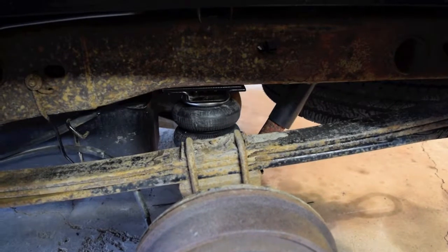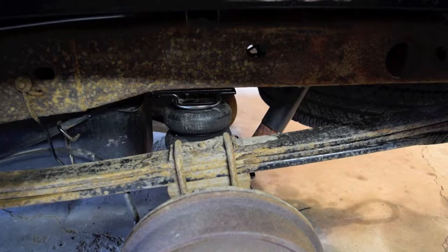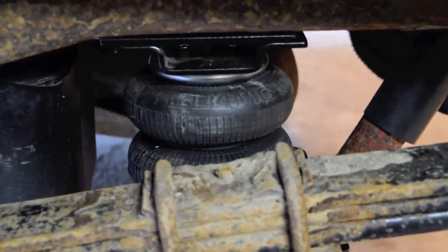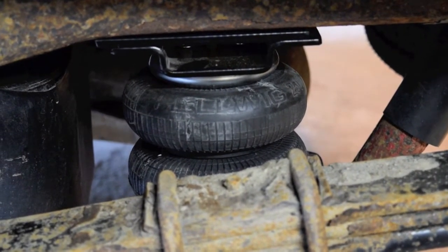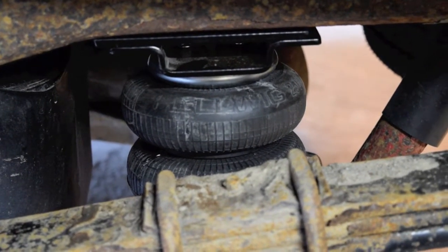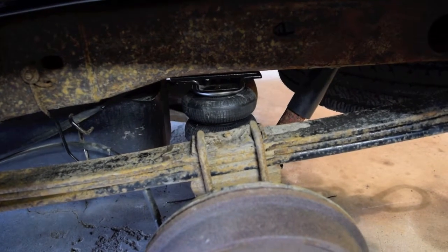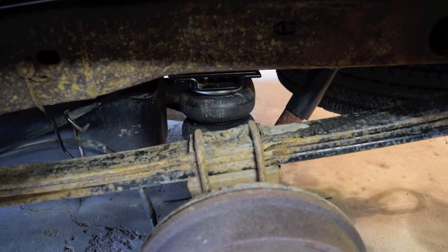This is the driver's side and the bags are inflated to 7 PSI. Instructions say do not run less than 5 PSI. We'll do a test and see whether 5 PSI is okay or whether I have to put it up to 7. All in all it was a good install — the only real problem I had was getting off the original bumpers, cutting off the rivet head and knocking it off.